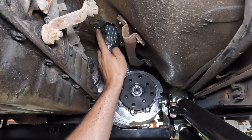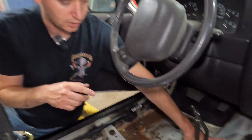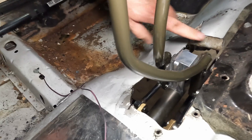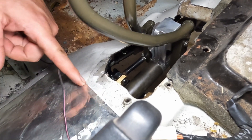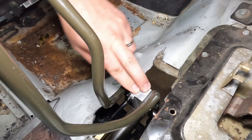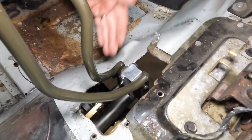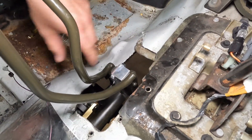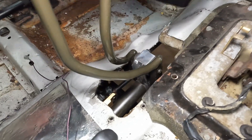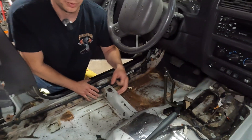One of the biggest challenges on the t-case install was the actual double handle. We had to peel the floor farther forward because there's a long stud that runs from there to the face of the transfer case. To get the aluminum housing on, you have to come in at an angle and roll it back. We're going to cut that section off, grab some sheet metal, clean it up, mold it in, seal it, then figure out the throw for the actual handles, cut as small a hole as possible to ensure clearance, and slip the rubber boot over. The center console will go back on later for a clean finish.